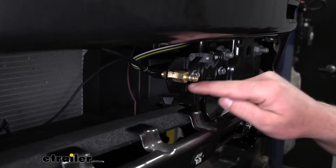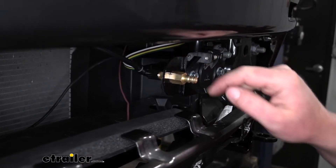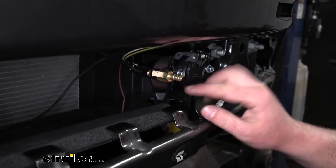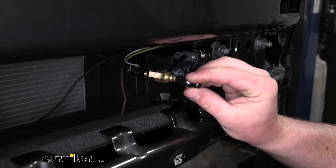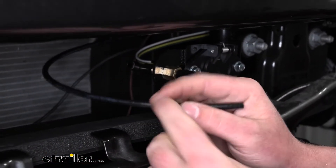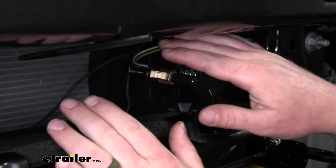With that done, we can hook up our air fitting. I straightened out the bracket — there's usually a 90-degree bend on the back — drilled a hole in the middle of it, then used the bolt holding on our six-way plug to secure it to that bracket. Then we hook up our airline tube, which simply plugs into the back of the fitting. That's how all airline fittings work.